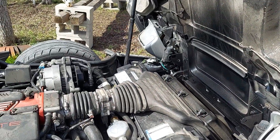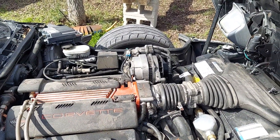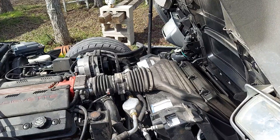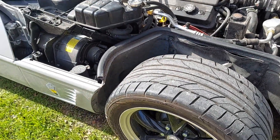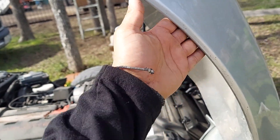Probably this side and the other side too. I didn't hit many bumps — I was just driving normally to the store, a five-minute drive, and it's already scraping. And of course I don't want it to scrape through the hood, so it also needs a better alignment. I'm probably gonna put a little more camber on it so it follows more the curvature of the hood.